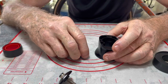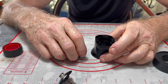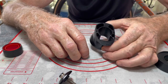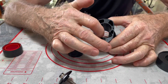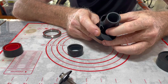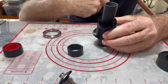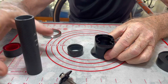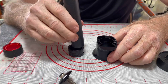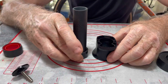I asked Jasmine at Yoleo what's the deal with the spacers. She said: you use the round spacers for the rim brake frame, you use the slotted spacers for the disc brake frame. The disc brake frame has fully internal cable routing. These slotted spacers are designed so the cables can go in that slot, the fork steering tube comes through, and there's still space in the front to run the cables down into the head tube and through the down tube.